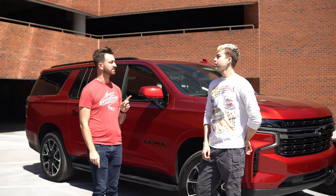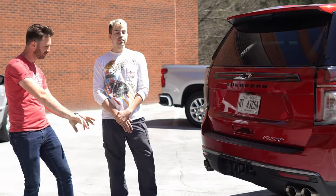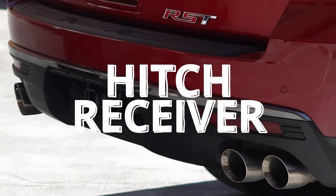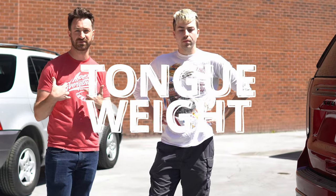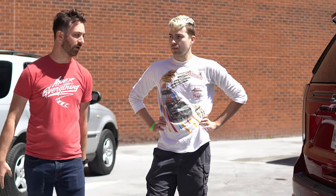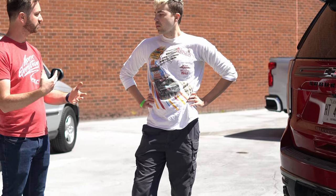But that's not the only thing that matters. So as you can see here, we've got the hitch exposed — there's a plastic beauty cover that includes the bumper look. This is the most normal hitch you'll see on pretty much anything: a two-inch receiver. The other important thing to note is tongue weight — that's how much weight the trailer puts right here on the hitch, basically on the back axle. Typically you can just assume 10% tongue weight is what is safe in the United States.